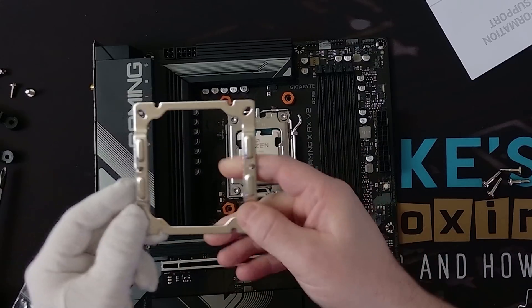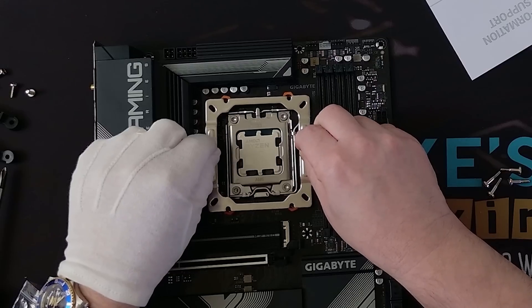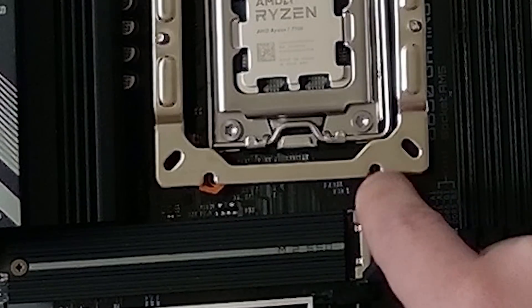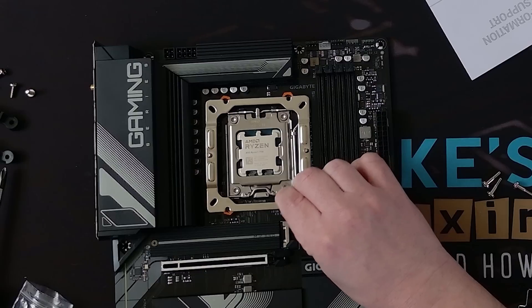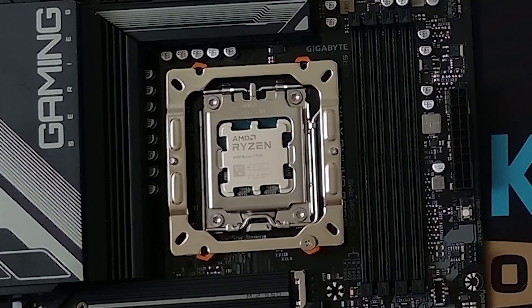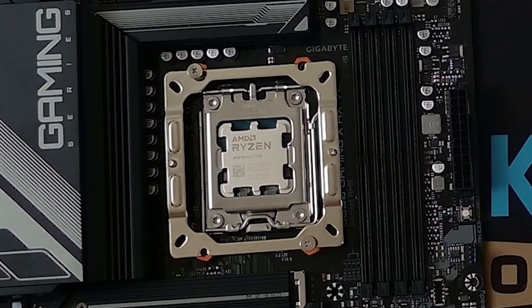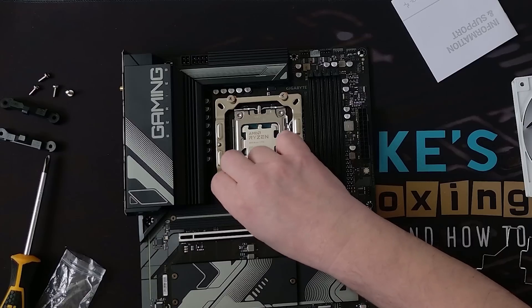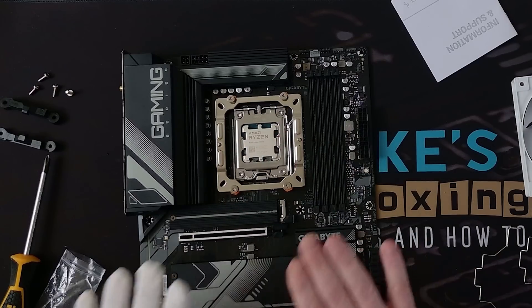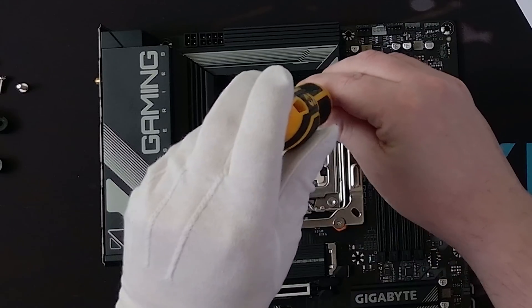Next, take your bracket or top plate and orient it so that the screw mountings are on the left and right-hand side of your motherboard, and just drop it down roughly into position. There are horseshoe sections at the top and bottom where the screws will go down through. Take your threaded screws and pop them down through the holes. I would suggest starting them in an opposite pattern to ensure the plate is centralized properly. Put all four screws in and start them by hand — this is considerably easier with the motherboard laid flat. If your system is vertical, put it on its back if you can. Then tighten them fully until they won't go any further.